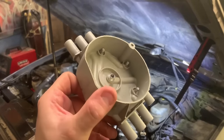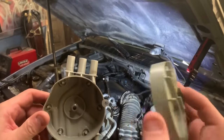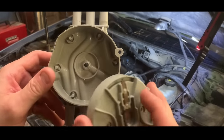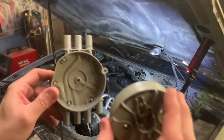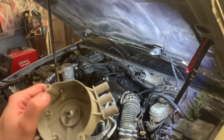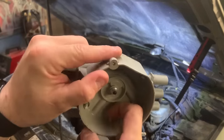Got a lot of corrosion in there - that's probably my issue. And I got a rusty rotor - these aren't great. I could sand both of these down and reuse them, but these are usually like 15-20 bucks a piece. I'm just going to go grab new ones, throw them on, and hopefully that's our issue. That corrosion is really bad - I bet that's why we didn't have great spark.